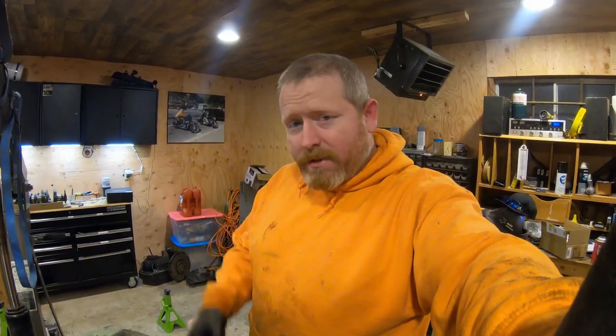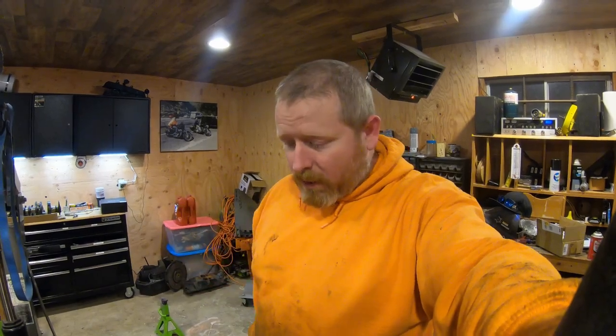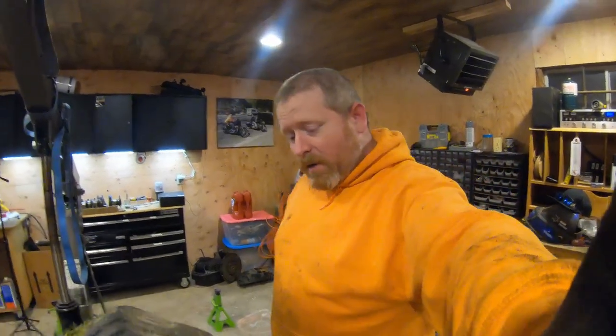The only other thing that I wanna say about it is be careful, it's a spring. It could slip, it could come back, hit you in the face, hit you in the eye. They've been known to do some serious damage. So at the very least, maybe gloves and definitely safety glasses when you're working with springs. There's a lot of stored energy there that you have to retension everything to make it go back on, so just be careful.